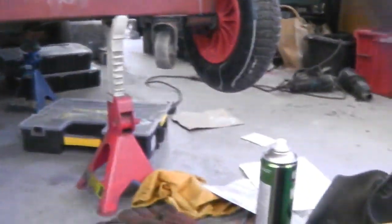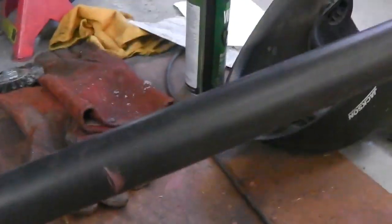Can you join me live? A little bit shaky, but I'm sure it's worth the trip underneath, even though the camera's going to shake. And we go for our reading. I've got to hold it up onto the chassis jig hole and then try and read it. With the camera it makes it a little difficult, but I'll mark it with my thumb, and it is 167, maybe 7 mil. Sorry about that.